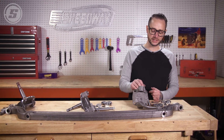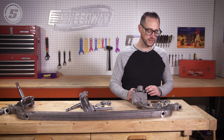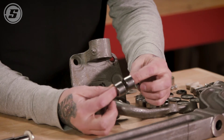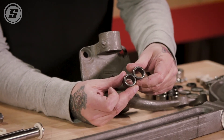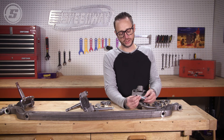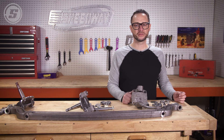There are so many differences in identifying early Ford spindles. The only real difference of the 42 to 48 kit is the kingpin is longer, so it's going to have a different configuration from the factory where sometimes the bearing was in a different spot. Our deluxe kits install the same way — we're still going to have the bearing on the bottom. In the 42 to 48, the two bearings are both the same size so it doesn't really matter which way you install them, except we like to see the lettering facing up. The kits come with this tool to press out the bushings, so if you have an old set of early Ford spindles you're able to press out the old bushings and install the bearings the same manner as in the 37 to 41 kit.